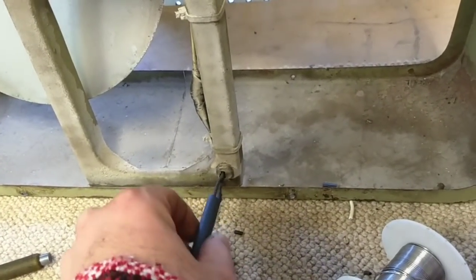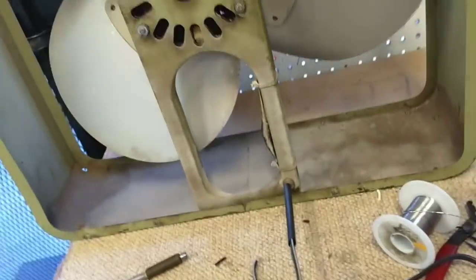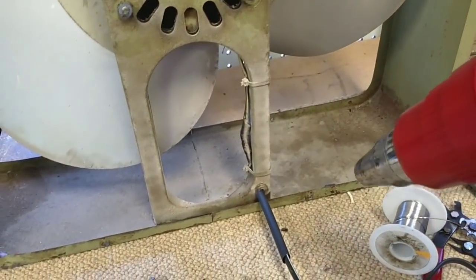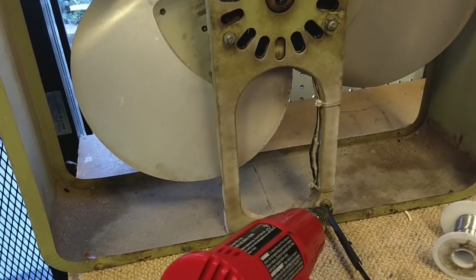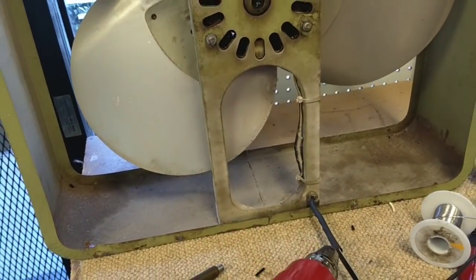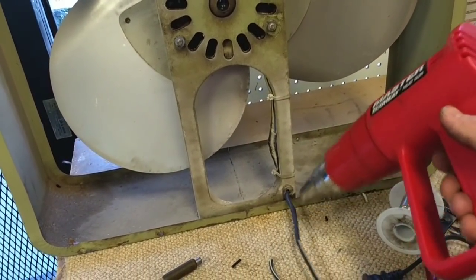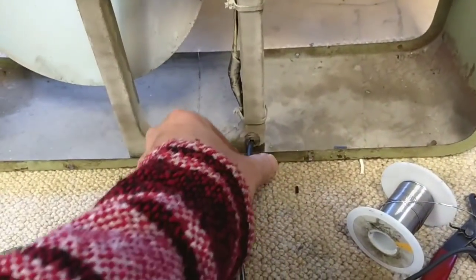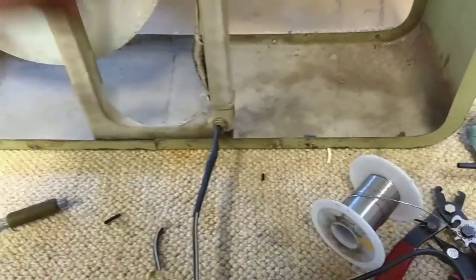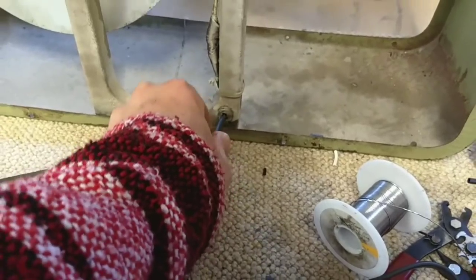What we're doing here is trying to eliminate the possibility that any kind of pulling, tugging, or failure of this mend will result in a short circuit. That's done - all nice and shrunk down there. The shrink tubing also adds a layer of protection in the event that this wants to chafe against the grill. So that works out well too.